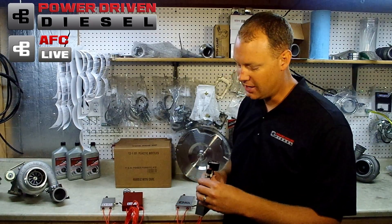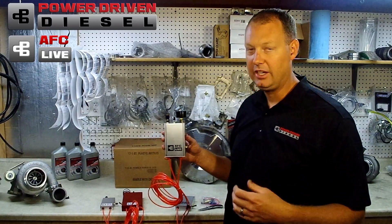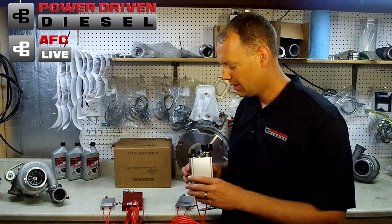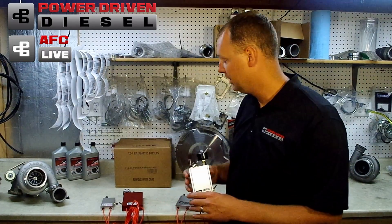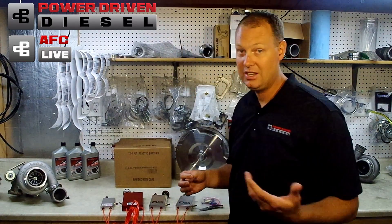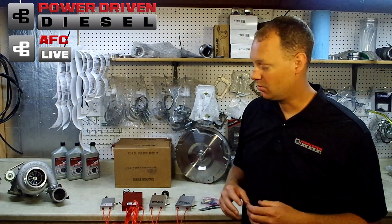You might find when you're towing your camper that you like 10 psi — that's perfect for EGT control. With the gauge, it's very easy to dial right to that setting. Some people just tune using their EGT as their gauge; if they get too much EGT, they'll back off the throttle. That's an option as well.